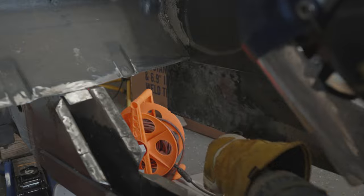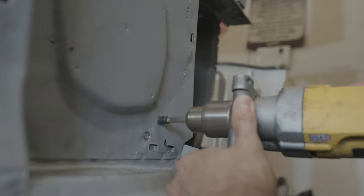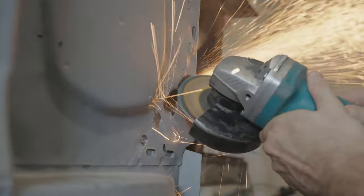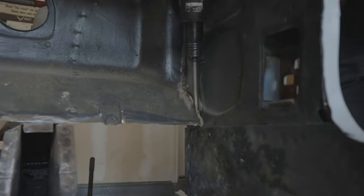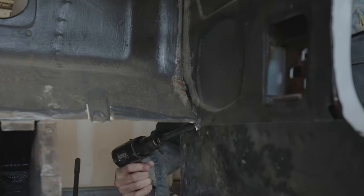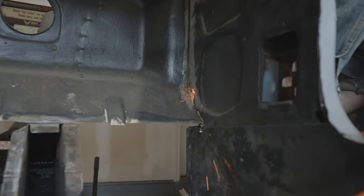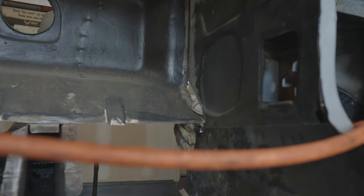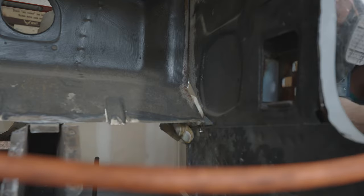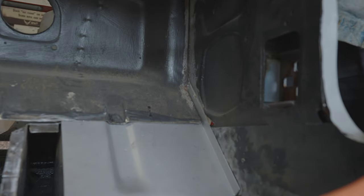Instead of dealing with the kick panel — which would mean pulling the dash out of a mangled mess — I'm going to clean up this rocker panel first so I have a nice clean slate for mounting the torque box with no hidden rust. Then I'm going to cut a small hole in the kick panel to gain access to my clamps and maneuver things around. Luckily I have an air hammer, which makes that a hell of a lot easier — it cuts through stuff like butter. I used cutoff discs to make the hole slightly bigger so I had just enough room to align the torque box.